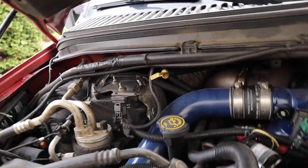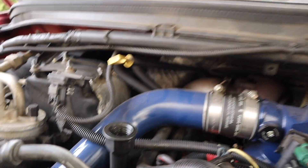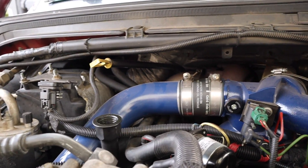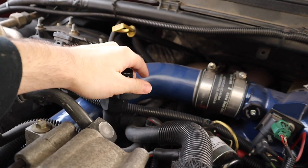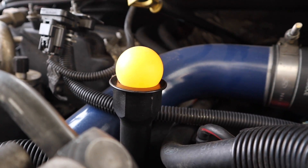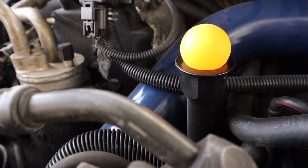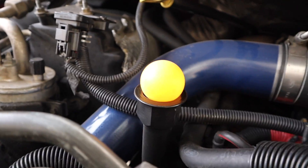For this part I'll do a voiceover because there's no way you'll be able to hear me over the engine and the fan noise. As you can see, taking off the oil cap there is a little bit of mist or vapor coming out of the filler tube — not a whole lot, but there's some. The cap itself keeps falling off but that's mainly because I'm sitting on the slope of the driveway, it's just vibrating off — it's not actually getting lifted and pushed off. Moving on to the ping-pong ball, you can see there is some pressure coming out, not a whole lot.